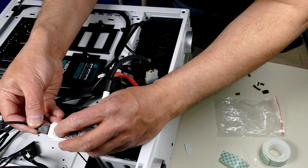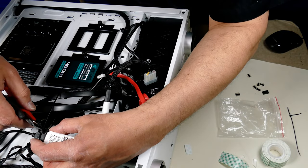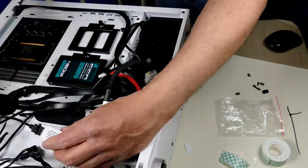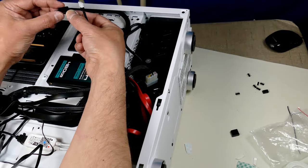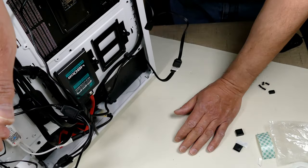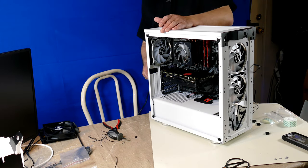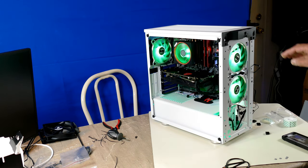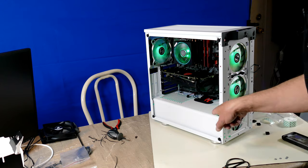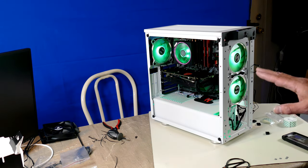Always make sure you have the little arrow on the plastic and the little red arrow on the connector that represents the 12 volts. By the way, if you ever want to tighten a tie wrap, you take the cutters and just touch it to hold it, then pull back just a little bit and do it a couple of times — that sucks it right through and usually it breaks off cleanly. Now all of the RGB is hooked up. Let's see if it comes on properly. I see everything lit — I see the back fan, the processor fan, the two front fans, and I see the little glow coming from behind and underneath from the PSU shroud. That is perfect — that's exactly the effect I wanted.